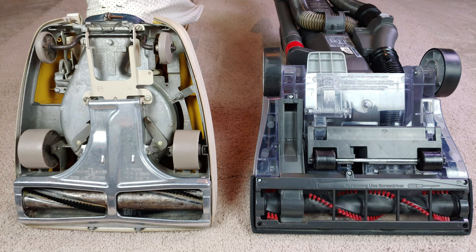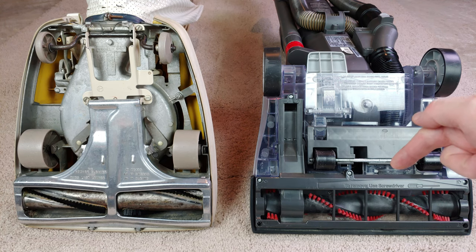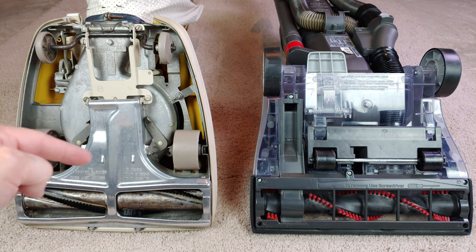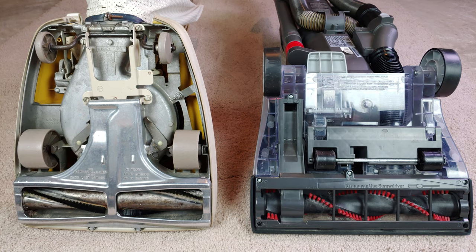The suction for both of these machines is just about the same. So the convertible, about 16 inches of sealed nozzle suction, and the Whole House Elite, about 18 inches of sealed nozzle suction. Lastly, the CFM, huge, huge difference. The convertible, 128 CFM, and the Whole House Elite, 55 CFM, with all the filters completely cleaned. Massive, massive difference there. So with all those differences, how is it going to do on sand?